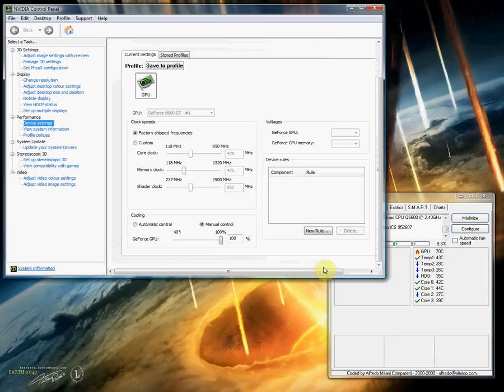The other easy ways, well, less easy ways to decrease temperature is to play about with the hardware. One of the most common things that can affect the temperature is that if the fan on the GPU itself is full up of dust, this means that the fan won't be able to do its job properly and it won't be able to get all the heat off the card itself. So I will be doing a follow-up video which will show taking out the card, taking off the fan and cleaning out all the dust, and then I will show the results. Following this, I'm going to install another fan which will be located just to the side of the graphics card on the case itself, and I'm hoping that this would knock it down a further few degrees.